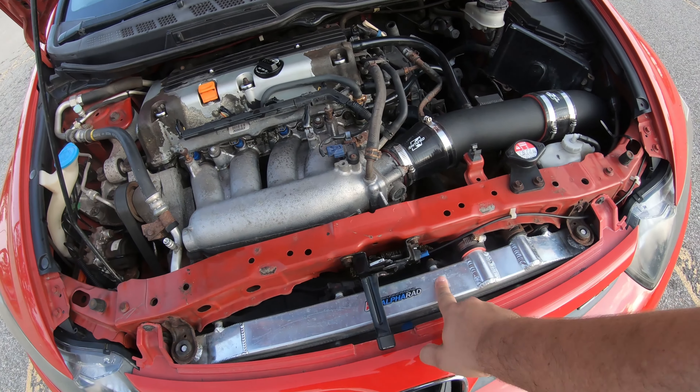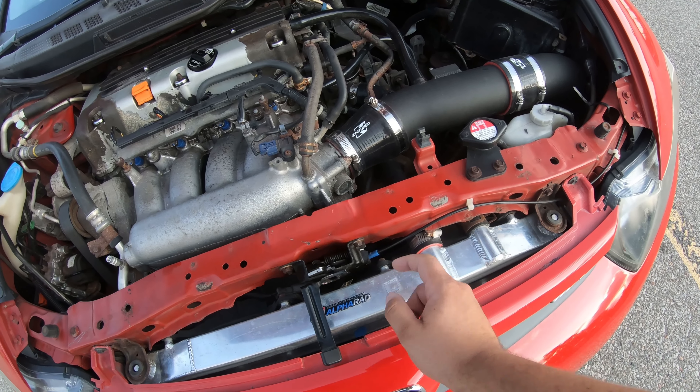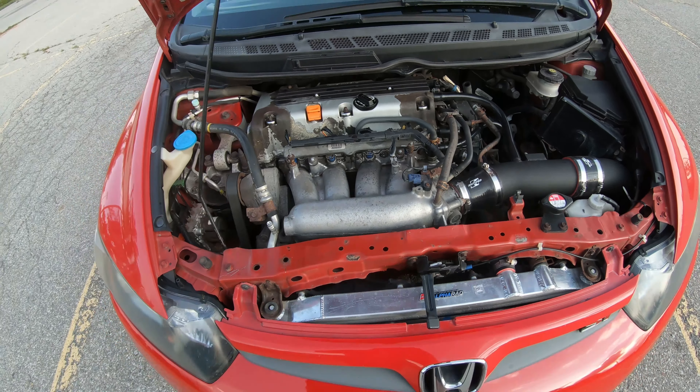Just giving an update on what's going on. As you saw in the last video, the Mazda is going to be down for the foreseeable future — at least until next season, maybe finished being restored sometime through winter. It's going to my shop, Adrena Garage. They're going to pull the motor, send it to a machine shop, take it apart, and blueprint it — measure every single clearance to see where my oil pressure's been going. If nothing's found, new oil pump and back together it goes.